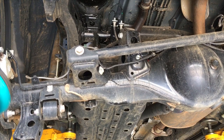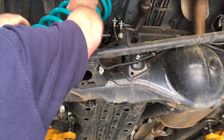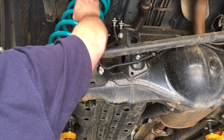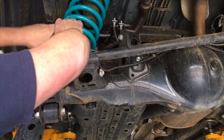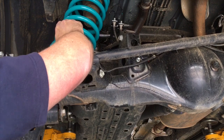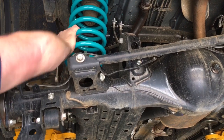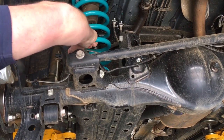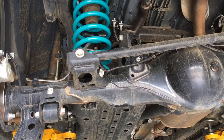Right, so we've got the 327s. C59327 is the part number. It's the most common, it's the medium rear spring. Right, so we just want to carefully get those up there, try not to scratch them. Right, and if we pull down, try and get the right position, give it a bit of a bouncy pull down, that should just pop in place like that. That's the hard part done, if you like, if that was hard.